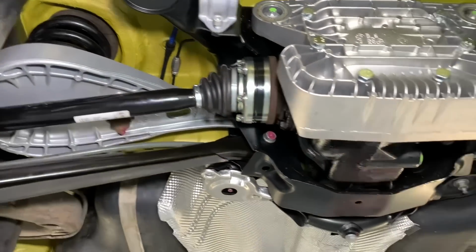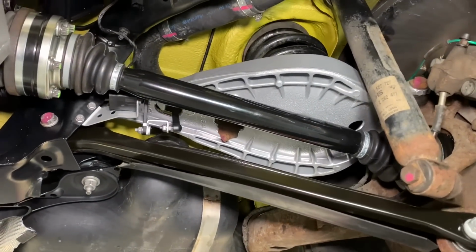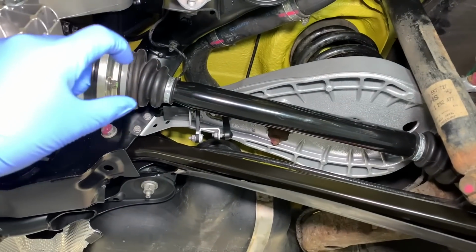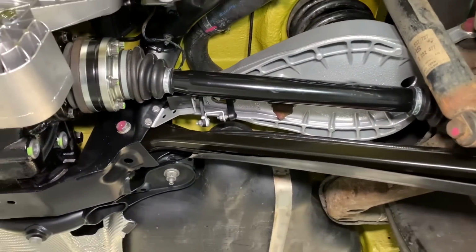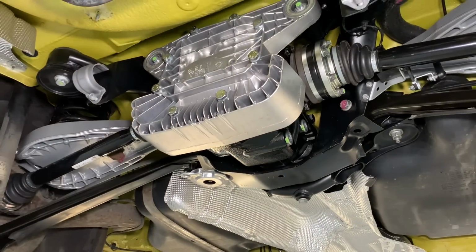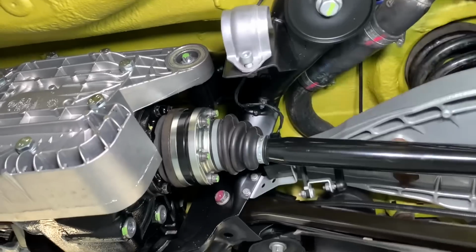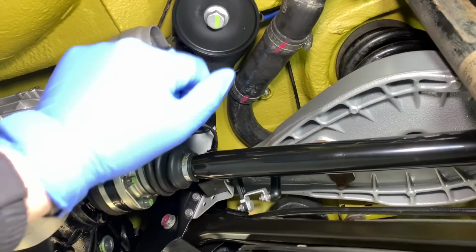We've gone for new drive shafts as well because there was play within the CV joints on these, and also the original ones do suffer with a little bit of paint loss in the middle, which isn't the be all and end all, but it's normally spline wear which we get between the CV joints on the inner and the outer, so that's why those ones are new. And then we've upgraded, since the last time we may have looked at this car, a few other key components. So we've gone for anti-roll bar brackets, these ones up here that have been changed for new ones, along with the socket cap bolts, powder coated subframe washers and new rear subframe bolts as well.